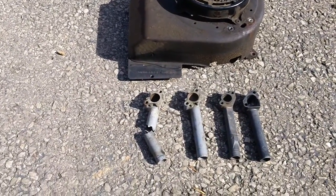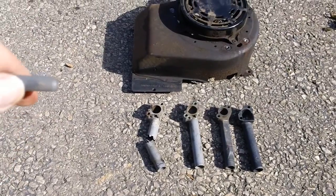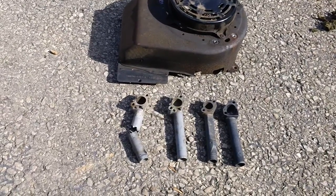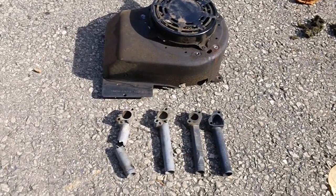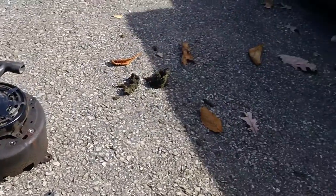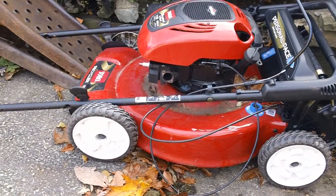Unfortunately the intake pipe on his was cracked in half because it was vibrating so much. The engine mounting bolts were nice and tight on the frame, so there's no problem with those. For whatever reason it seems to be these engines they put on either the log splitter or the wood chipper are having more problems than your typical lawnmower-style engines. Normally on a lawnmower they hardly ever break — I've only replaced maybe one in about eight years.